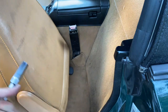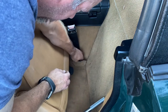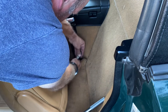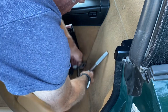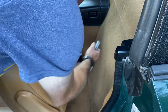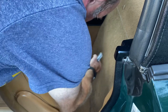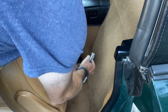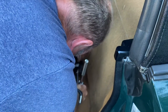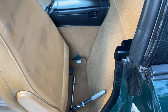So 16 millimeter or 5/8 will get it done. We'll loosen this off and unplug the electrical connector — just pull this flap of carpet down, fish out the electrical connector, unclip it, and wriggle it loose. Once that's out, I'll show you how nasty this one is.